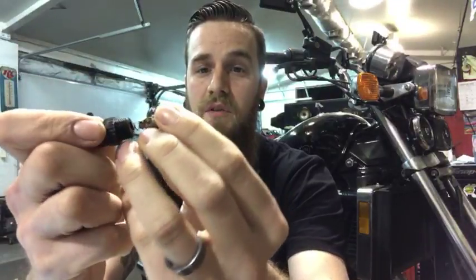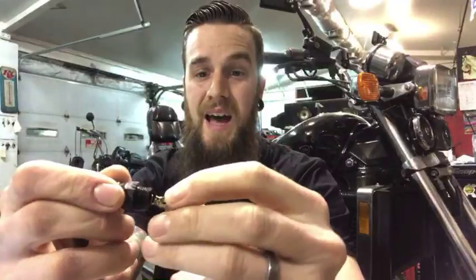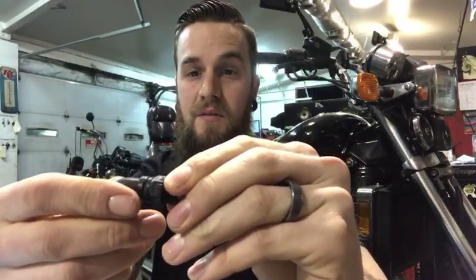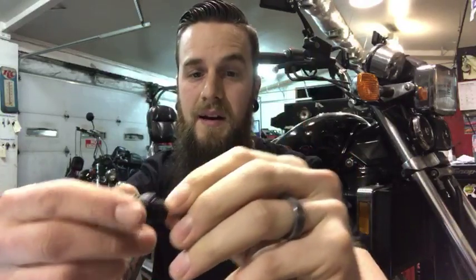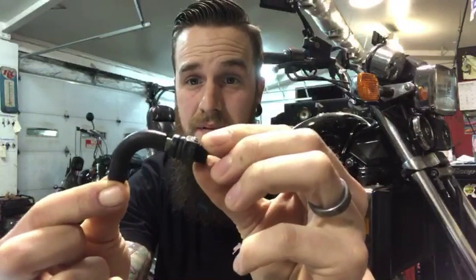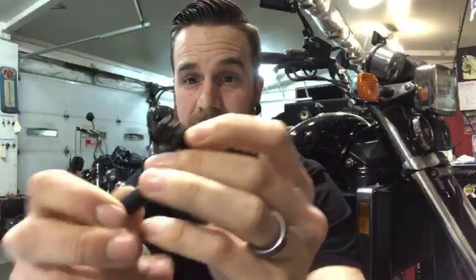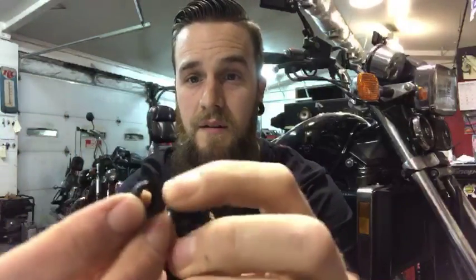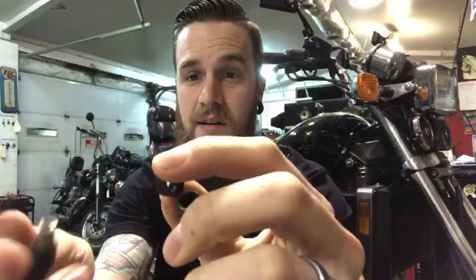You pull the choke cable and it pulls this plunger back all the way inside the body. But where this black plastic fitting fits into the carb body, this little rubber elbow actually plays a huge role. Because once these rip like this, where it leaves that lipped part on, see that? This is actually supposed to be on there like that.